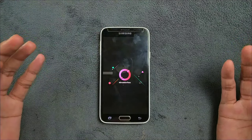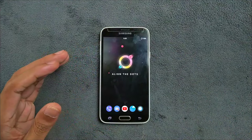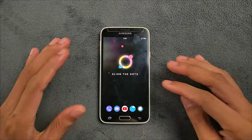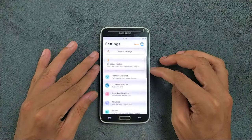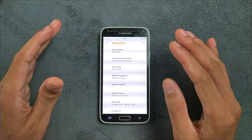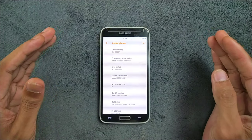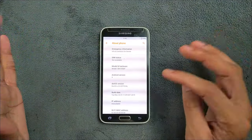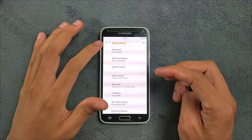If you are new here or if you have a Samsung Galaxy S5, you can check out my older videos too — if you're really into custom ROMs you can choose the best one for you. The ROM is booted up, and going to Settings > About Phone, this ROM is for the Snapdragon variant only. If you have an Exynos variant of the Samsung Galaxy S5, do not flash this ROM — it might brick your phone and you may not be able to recover it. As you can see, this is Android 9 Dot OS version 3.0 official build, with a build date of March 26, 2019.